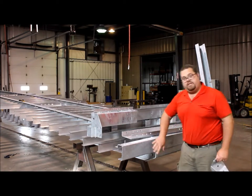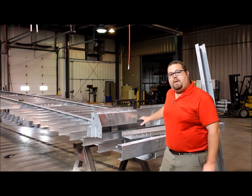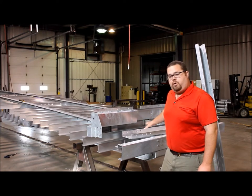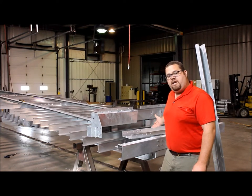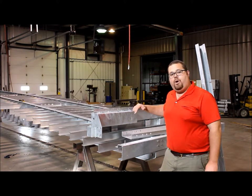So again, in the case of galvanization like this trailer, or in the case of a blasted and painted trailer, you actually get paint or galvanization in all of the creases, in all of the cracks, up underneath the kingpin assembly — so you don't end up with naked metal running down the road, and you won't see those brown streaks on your trailer at a later time.